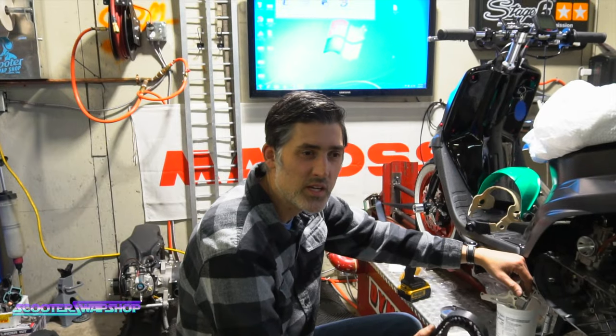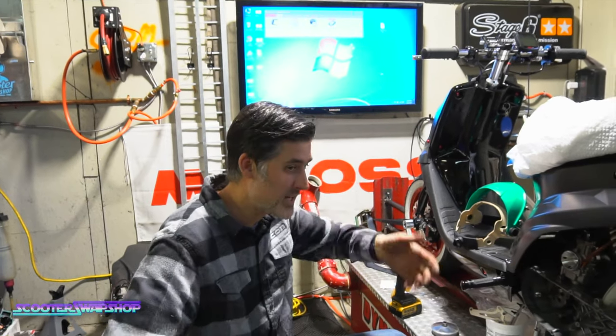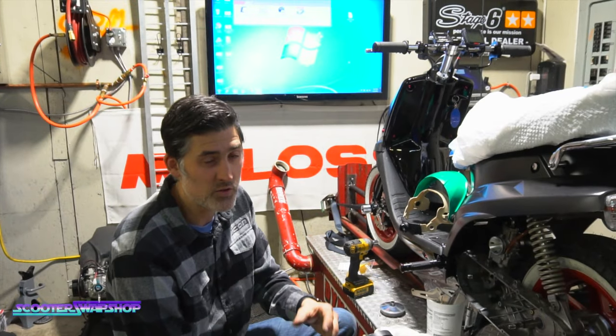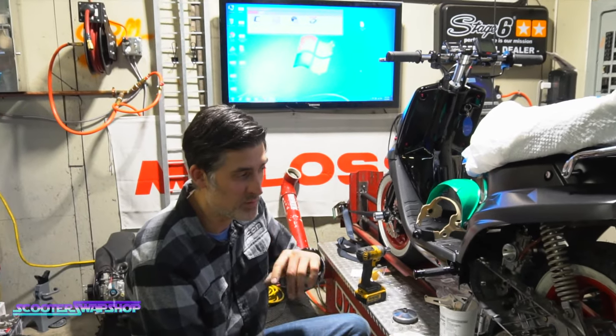Went to Super Sunday and let Kale ride it one year on it, and he hit the throttle and looped out. Clutch spring, having it set up right, is the difference between a bike that you have to use your feet to accelerate on and a bike that will flip over from a dead stop.